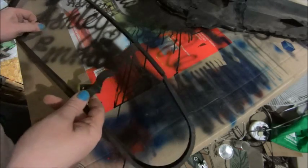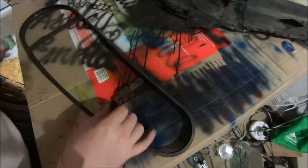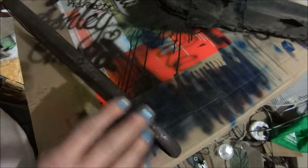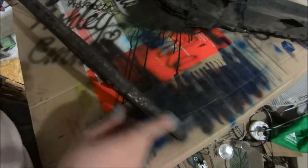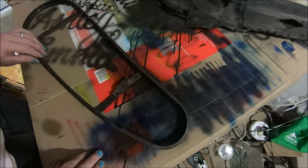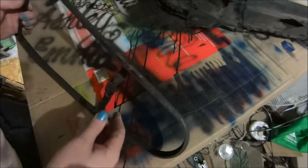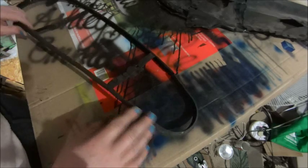That coat guard goes on this, which has cleaned up a fair bit. You might have a look at my other video on setting up an electrolysis tank for rust removal — I've had this in there for a couple of days and it's all cleaned up. There's not a lot of paint left on it; I don't think the electrolysis has really lifted the paint, I haven't had it in there long enough. But all the rust is gone and I think I'm just going to go ahead and completely repaint the bike. I'm going to put a coat of satin on it and some pin striping.